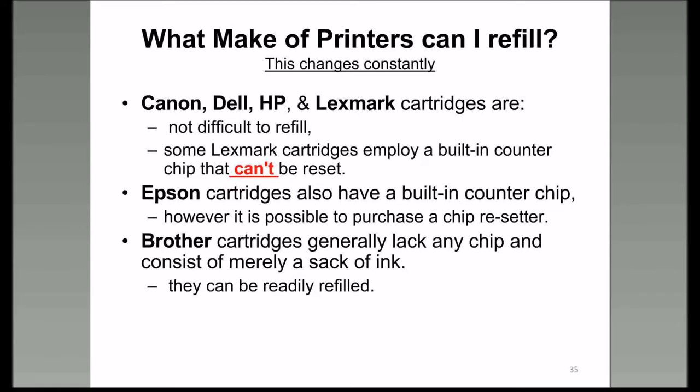I've gotten feedback from people who say, 'I have a Hewlett Packard, Dell, Canon, whatever printer, and if I leave it on, after fifteen minutes it seems to shut off.' My experience is that the printer is really going into a sleep mode, not shutting off. Once you send a command from your computer to print, it will automatically wake up and go back to work. It's going to sleep, and it doesn't normally go to the parked position and dump the ink.